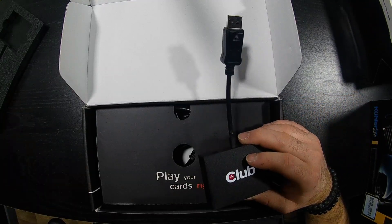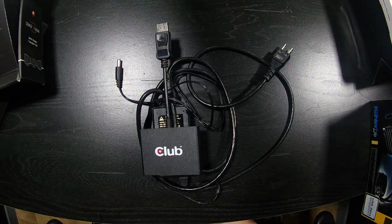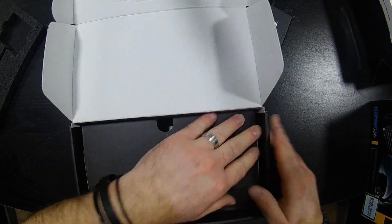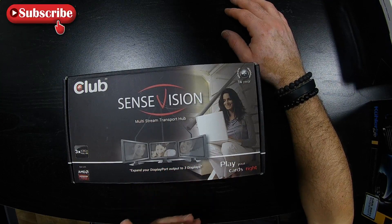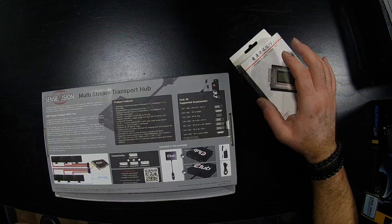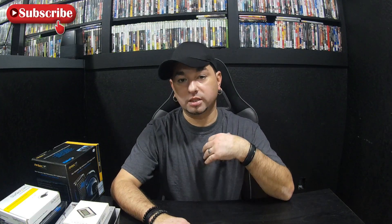The box does all the processing so your system is only rendering one image. It comes with its own power supply — 5V 2.4A — to power the unit. A lot of older games don't have native multi-screen support, so this is my solution. Your video card does need some power but you don't need to spend $400 on a card for this to work. It requires no drivers, and you can convert the display port outputs to HDMI, VGA, or DVI — but you need active adapters with a chip inside, not just passive converters. Imagine playing Doom 64 across three screens — it's going to be awesome. I'll leave all the links in the description. Thanks for watching — that wraps up another PC peripherals unboxing.